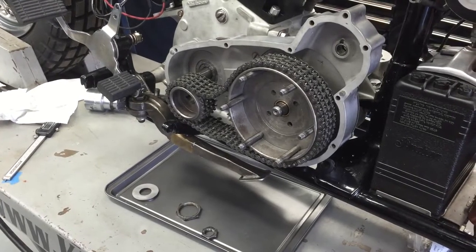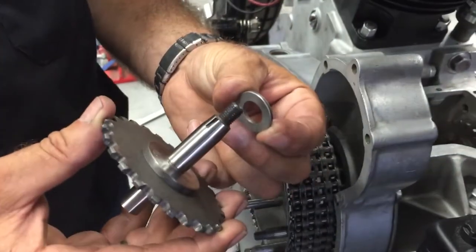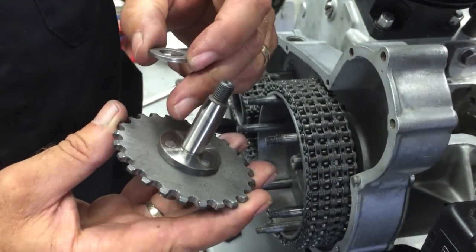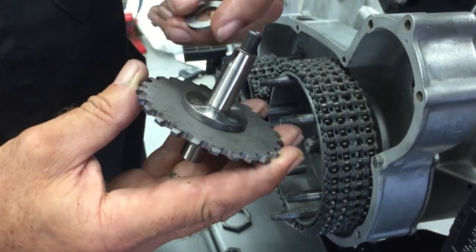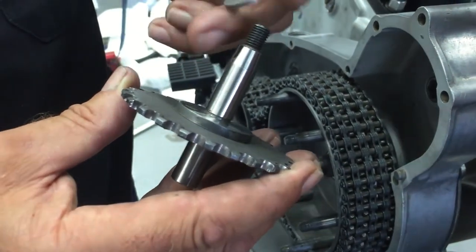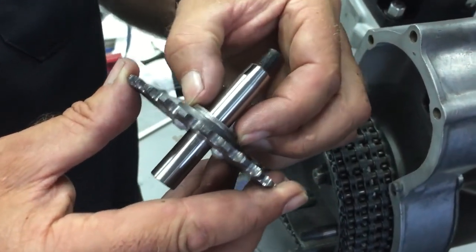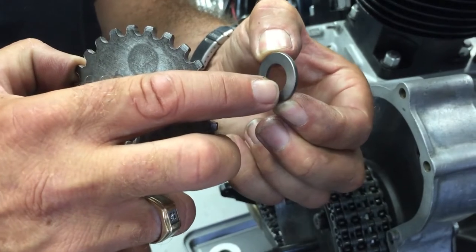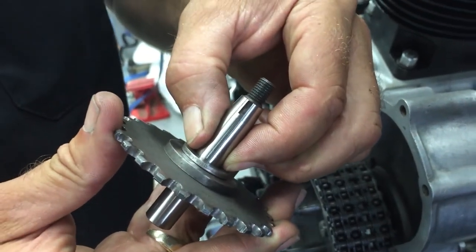Put the primary chain on, and we're going to check for generator sprocket alignment in the chain. This is the thrust washer that goes on the back — hardened. This sprocket has been re-riveted onto a new shaft. Always make sure that the rivets are down the same level as the flange itself. Sometimes different manufacturers put too big a radius in the shaft diameter to the flange, and it'll hold the thrust washer off the surface — it'll actually be elevated a little bit. If that's the case, come back with a die grinder and grind a bevel on the inside of this so it sits down nice and flush, right up against the flange.